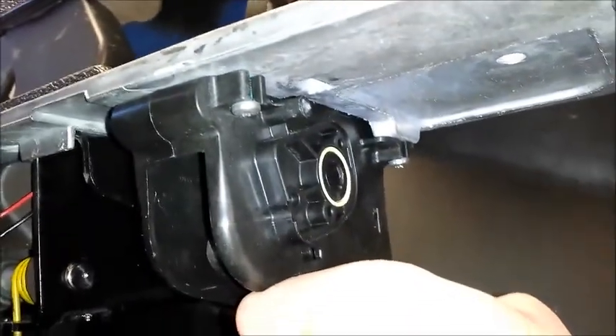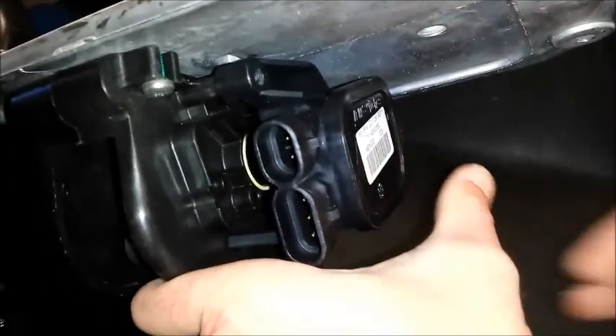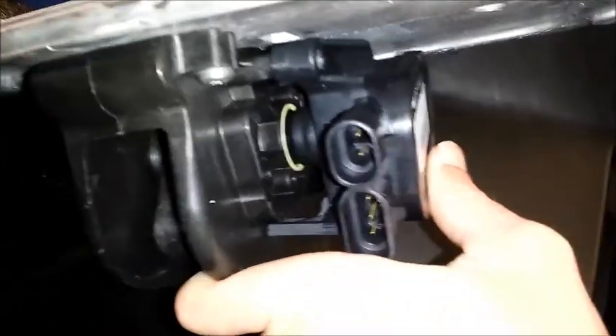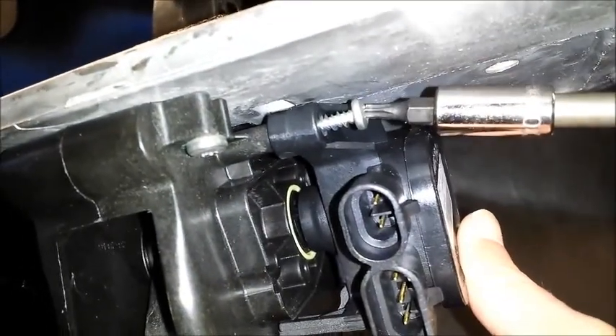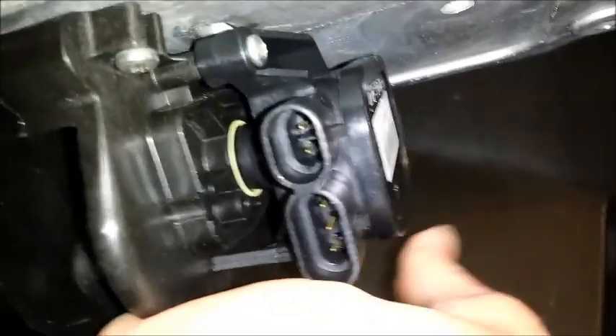You might want to give it a little shot of lubricant right in there. There's a prong here, a prong there, and then it fits flush. When the old M-Core comes out, the new M-Core attaches just like that. Then take that small screw and get it started — just like that. Then reattach the wires.